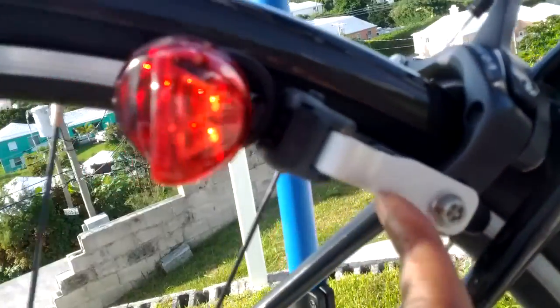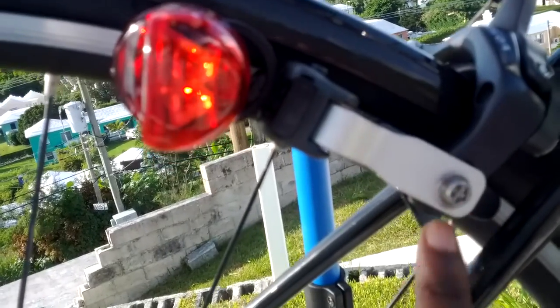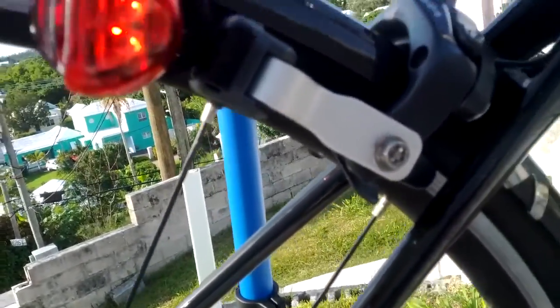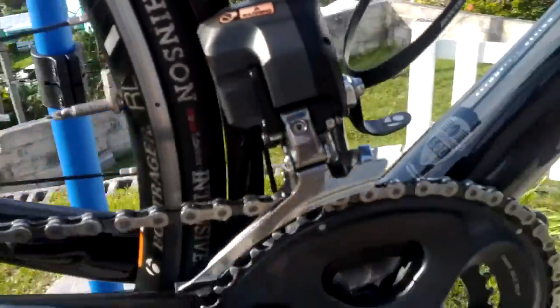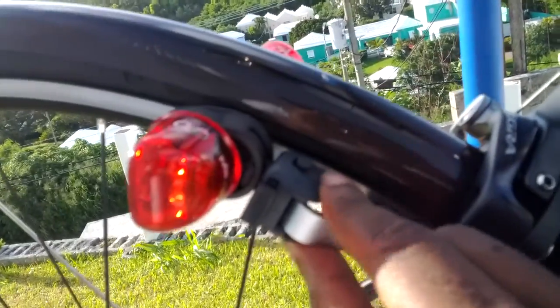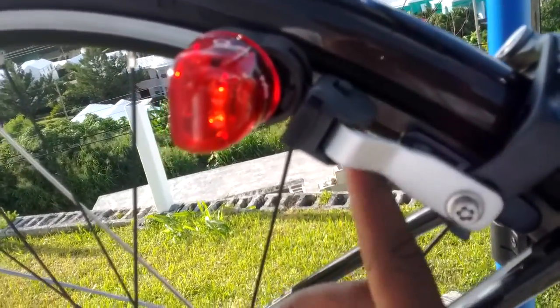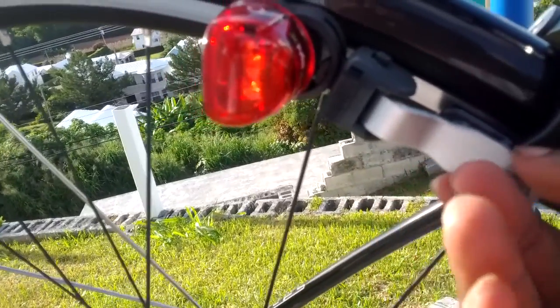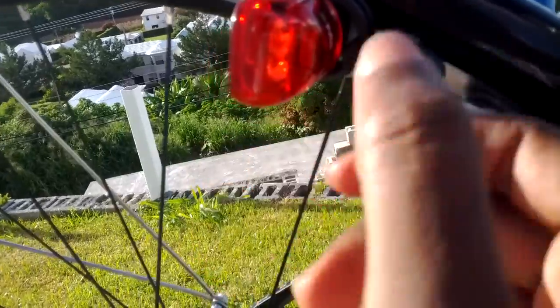The rear fender could fit because the back one doesn't go into the bracket — it's just straight onto the brake arms, and they give you these extra-long security bolts to go with it. So you don't have to worry about whether your fender will fit with that on, if you're just doing this for winter. These do move when you work the brake, so you have to adjust this piece here. There's a bolt underneath you connect it with. Again, they don't send you a hex key that fits that, so you have to have your own so you don't have to take the whole thing off to tighten and adjust the distance from your rim.